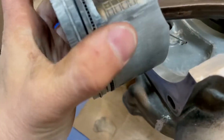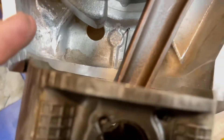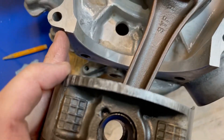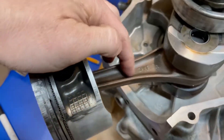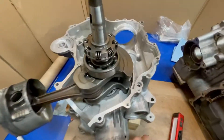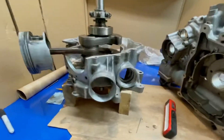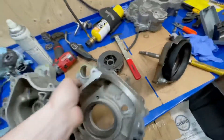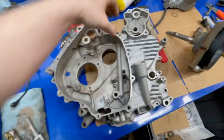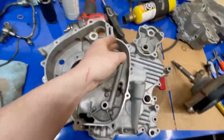With the piston on this side you're actually still spraying the wrist pin. As it keeps going up it's going to spray the backs of the piston, so the oil will hit the side of the rod and spread out. One thing - like I said - these motors don't have any oiling for the motor directly, so they rely on oil flinging up on this side here. The balance shaft on this side - and your chain picks up oil and splashes around this area. It's kind of primitive.